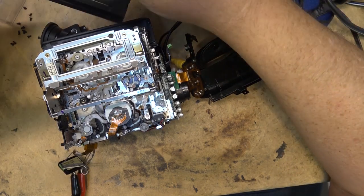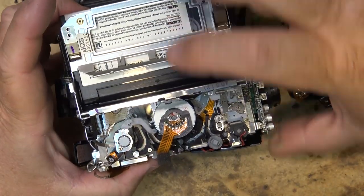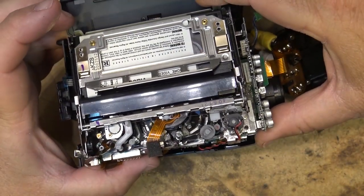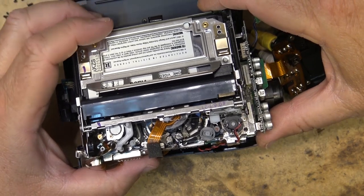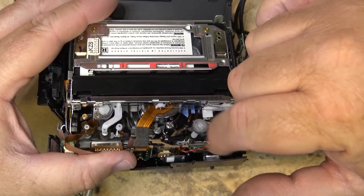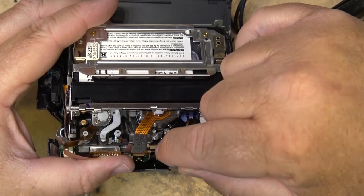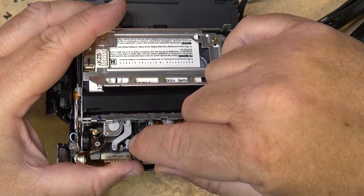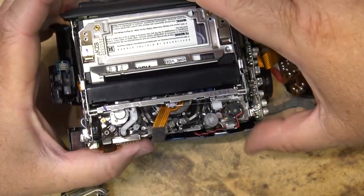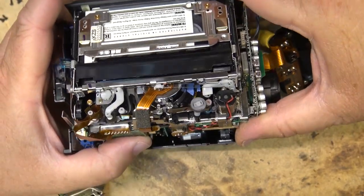I'll show you guys a good close-up of how these micro mechanisms load because they wrap the tape more than 180 degrees — almost 360. Watch the loading mechanism when it loads up. As you can see, the tape is wrapped almost 360 degrees. It's brought out, brought around here, around this tensioning arm and tape stabilizer, and then it wraps around the head drum starting here and ending over here. Then around another set of guides, another stabilizing roller, and then the pinch roller and capstan shaft is over here. No problem with the way the tape runs — it's running fine, it's just not producing a picture.